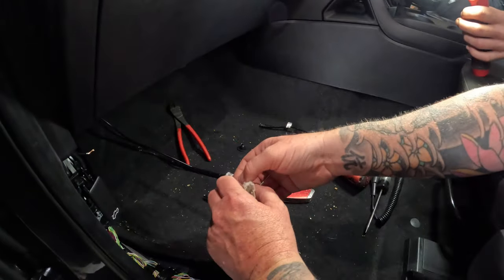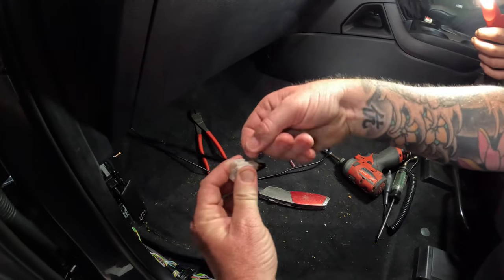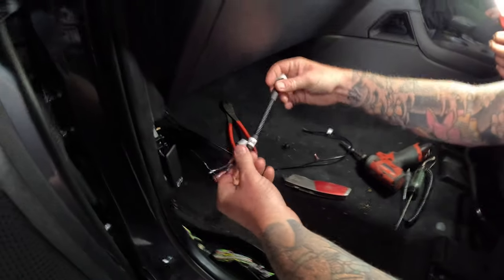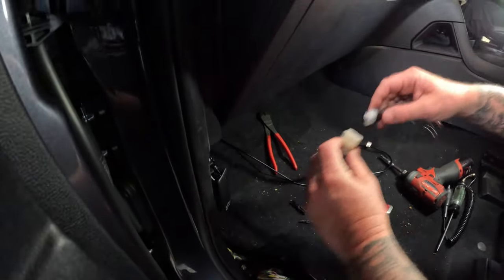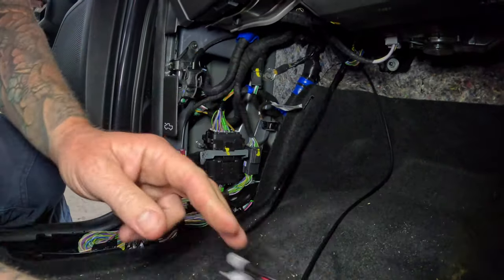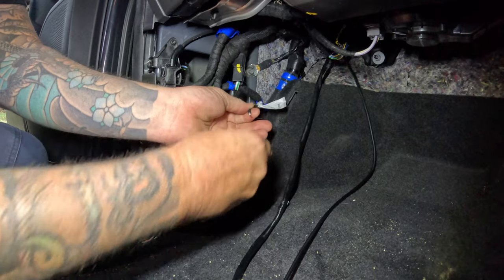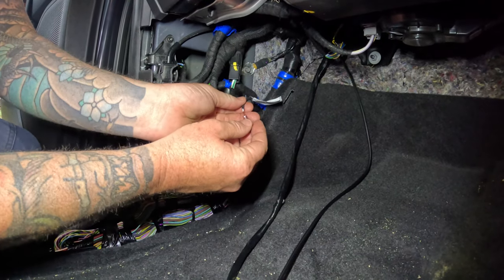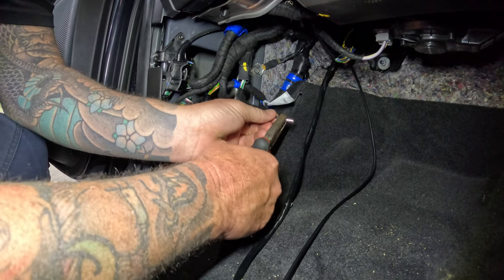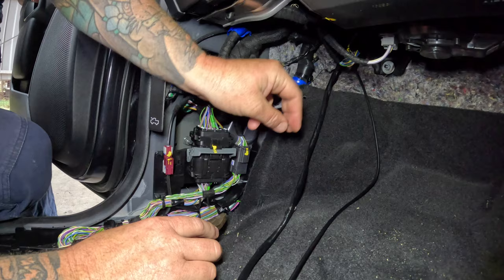Next step: we grab the high beam adapter. We plug in this beautiful high beam adapter and clip it like so. Now here's our high beam wire — we just twist this wire up so it's nice and tidy. Get our supplied crimp fitting, feed it on there like that. I've just got a set of pliers for this — if you haven't got crimpers at home, just to show you it can be done. Give her a bit of brute force. And we're crimped on — beautiful.